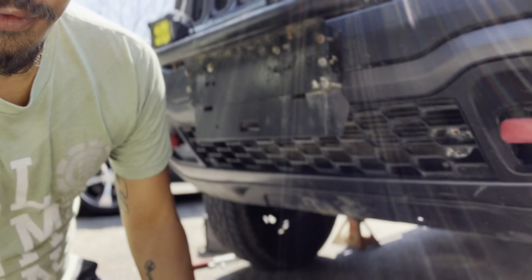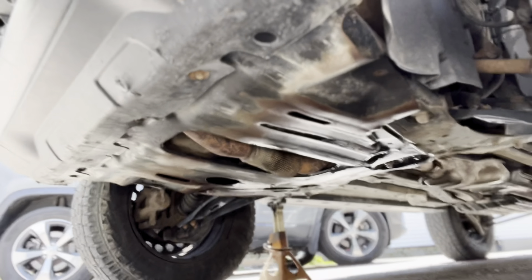What's up guys, so we have another video today. Today we're going to do the lower transmission mount that goes into the torque mount. First of all, you're going to take off your skid plate. For your skid plate it's 13 millimeter bolts, 10 millimeters, and a T40 torx bit for the rears. Jack up your vehicle and then take off your skid plate and we'll get under there and go from there.